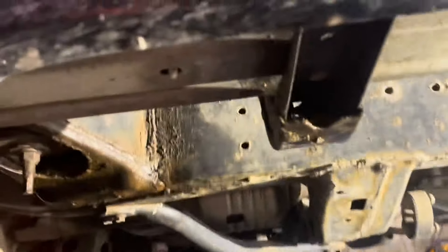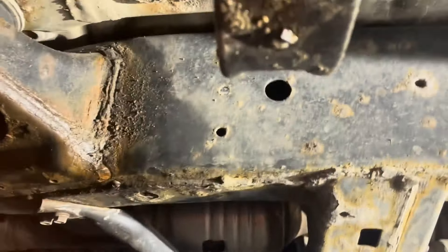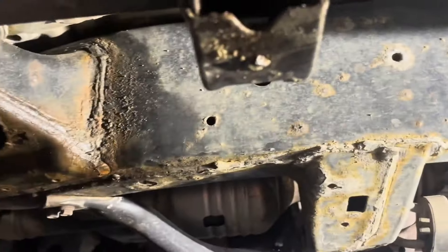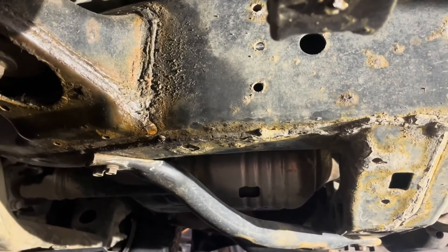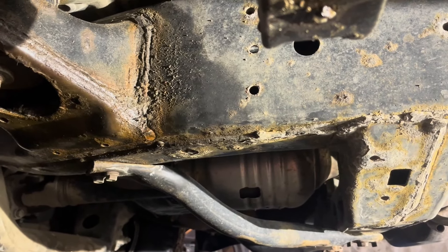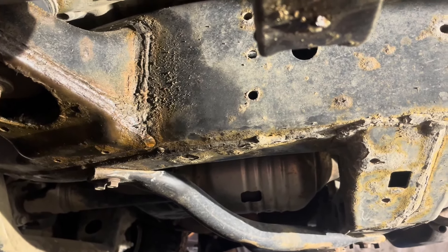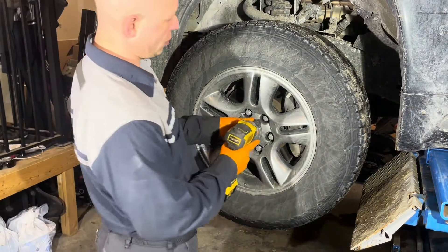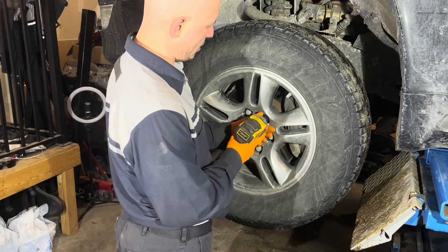You'll need to lift the front wheels off the ground to do the brake job. With this vehicle you can lift it up anywhere on the frame rail. Make sure you secure it with jack stands — don't just use a jack because they're not very reliable and they can collapse and hurt you very badly. Once the vehicle is lifted and secured, remove the front wheels using a 21 millimeter socket.